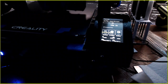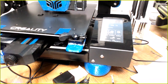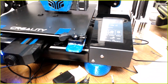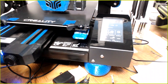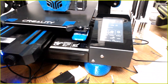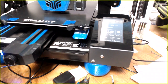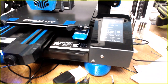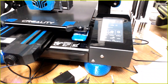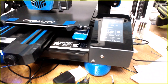Alright, well, I'm going to cut this here for a moment. For you, for me it's going to be 4 hours. But I'm going to cut this for 4 hours. Come back with the other firmware already installed on the motherboard, or the LCD board. I'm not going to do anything with the firmware itself, just the DWIN folder. Put the stock Community firmware in there, the New Year edition, and try to print from the SD card. We'll know right away if it's what's going on at that point.